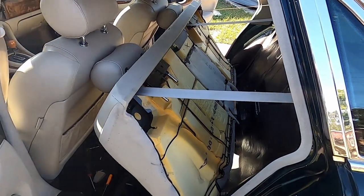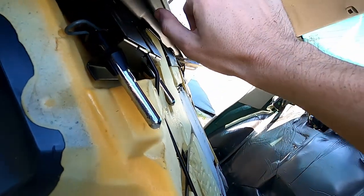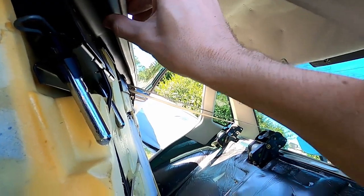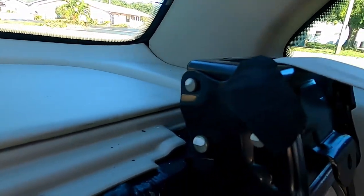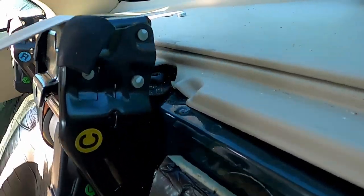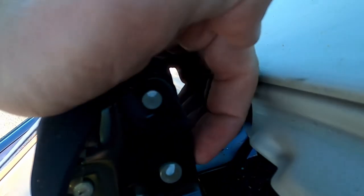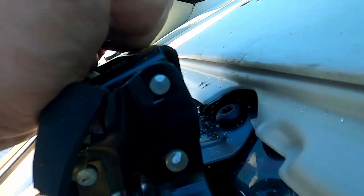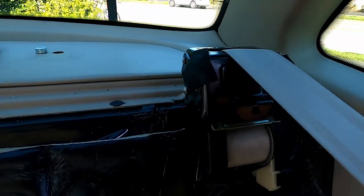I'll call that a success. This lip right under here which pokes inward basically hooks behind these little seat belt guides. You've got to get the lip up and over because it starts all the way down here — so you have to lift pretty high and then get forward. The thing you're fighting is three contact points, one at each of these seat belt guides.